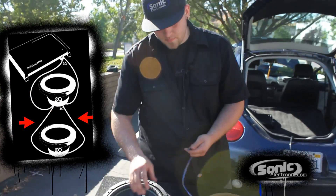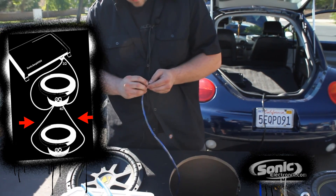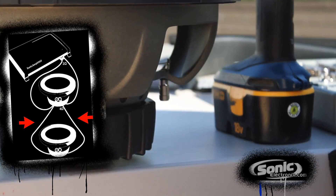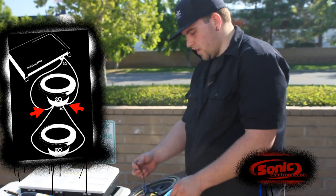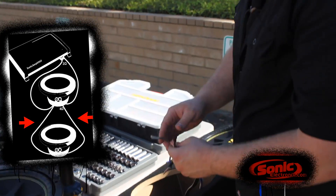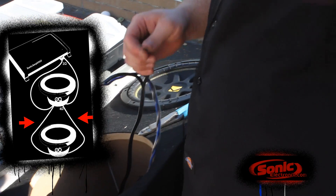Got the other side here. We got the main wire going to the box terminal on the left-hand side — that's where I'm going to be connecting the main amplifier output right to here. We got the sub wire from the first kicker woofer. This is going to be the secondary wire right here, which I'm twisting together. If I can join these two, you're going to have a final impedance of 2 ohms.